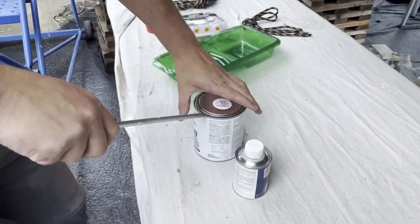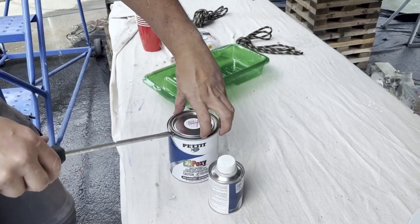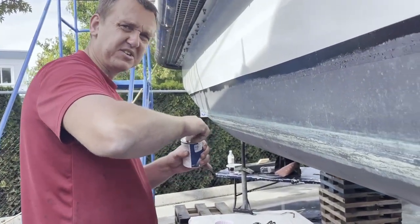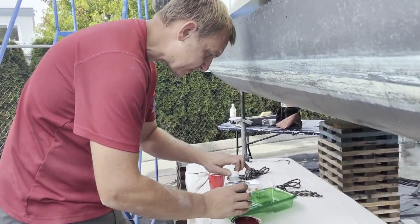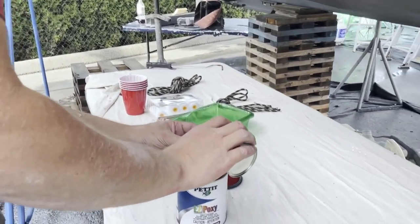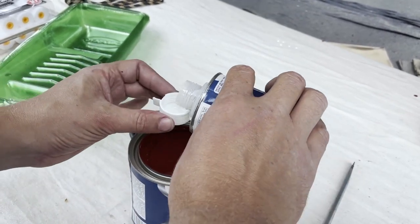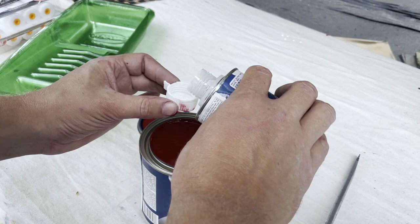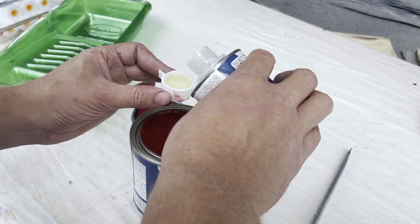Where's your mixing pot? We're going to mix the whole thing. As you can see, we're using Pettit, and this is just sort of a hardener or protective additive that you add to this, so you put it in right before you paint. You can only add it for a certain amount of time before you paint. We knew we were going to use the whole can, so it was okay to do it. Otherwise, you measure both parts and mix separately so that you don't contaminate your main paint container before you're ready to go.